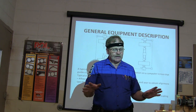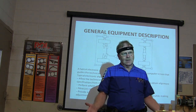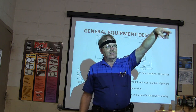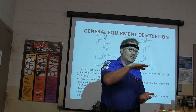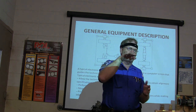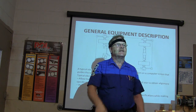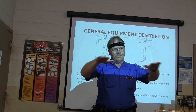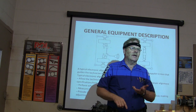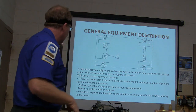Put your pins in before you ever get the car off the lift — do that the same way every time. Secondly, when you raise that lift up, make sure it goes clank clank clank, and the one on the right front corner is the highest one. If you don't quite get above that corner and you go to lower it on the lock, the car will try to go down on that corner because it's not on the lock. Always set it on the lock so it'll be level. If it's not level, you won't get good readings either. So close the doors, be careful with the turn plates, and make sure it's level when you do your work.